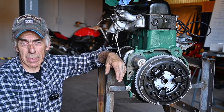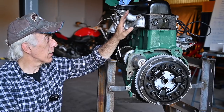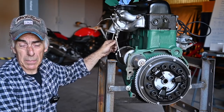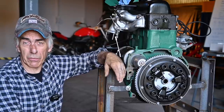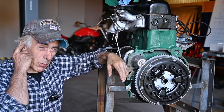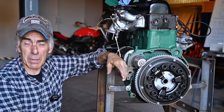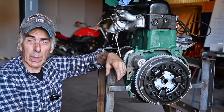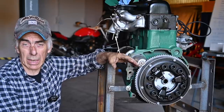We're nearing the end of this video and we did quite a bit of work. We installed the flywheel, the clutch, the pressure plate, the intake manifold, and the exhaust manifold. We replaced the studs on the exhaust manifold — that was a bit of work. We also took the carburetor apart and started cleaning it up — that's still in process. We took the distributor apart and reassembled it: new points, new rotor, new capacitor. We checked everything, tested it on the bench, and then installed it on the motor where we verified it fires at the right moment.